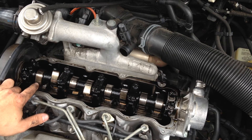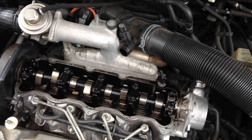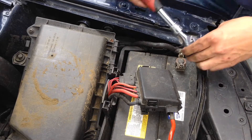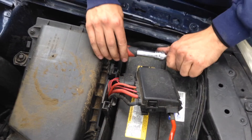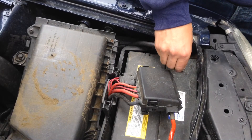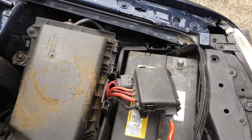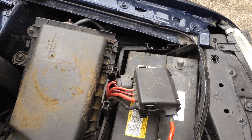With the cover off, cylinder one is not pushing down, which is good — we're likely very close to top dead center. Now is a good time to disconnect the battery before we go further. You wouldn't want someone to start the car with everything taken apart. We disconnect it using a size 10.